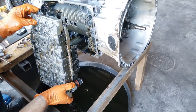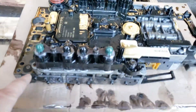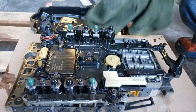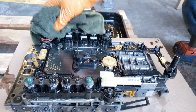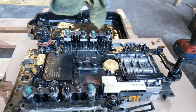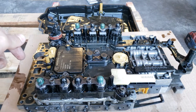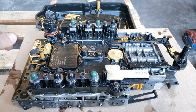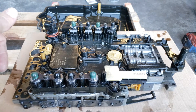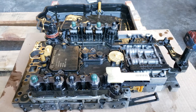This is your valve body — the metal part — and the upper plastic piece is going to be your conductor plate. The conductor plate is registered to your vehicle with a specific VIN number, programmed, so you can't just switch over a transmission. If it's a 7229 transmission you're going to have to have the conductor plate flashed, virginized, and then adapted to your vehicle's specific VIN number. If you're buying a used transmission it's not going to work unless you have the conductor plate programmed to your vehicle. But if you're getting a used transmission you could always swap your old conductor plate into the new transmission since it's already programmed to your vehicle — unless the conductor plate is faulty.